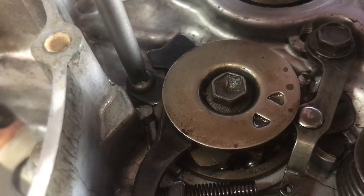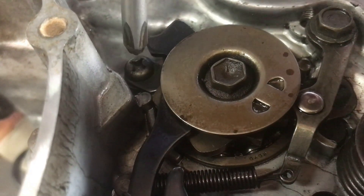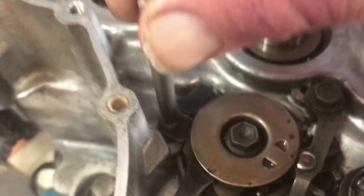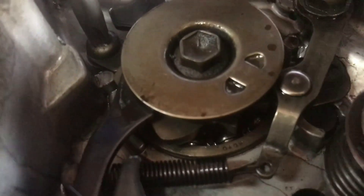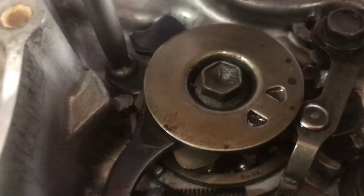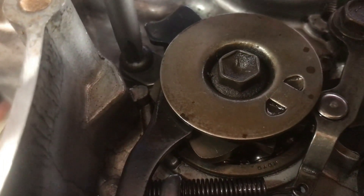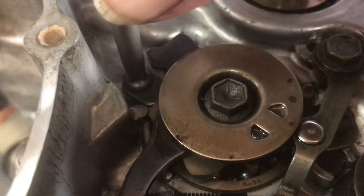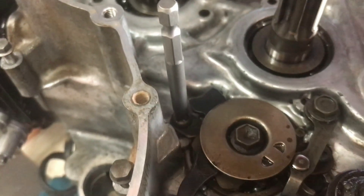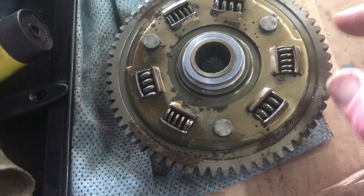There's another screw there holding the barrel bearing in, and this tip I used on the oil pump is the same type of screw - I've got no play in that tip at all and it just slots in. It's obviously made to fit. It's JIS standard; the heads of the bolts have got one little center punch mark on them indicating they're JIS. All these Phillips heads in the Suzuki are JIS, and with the right screwdriver you've got no problems getting them out.